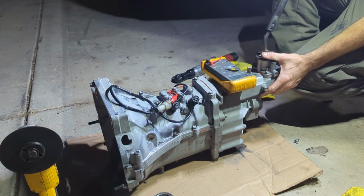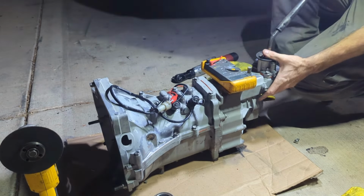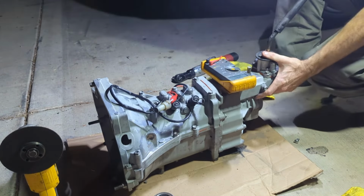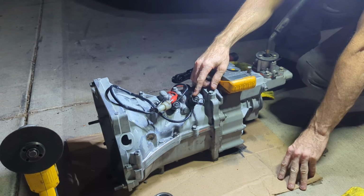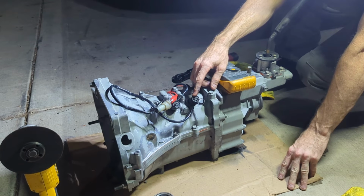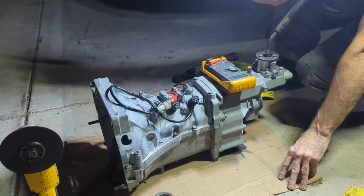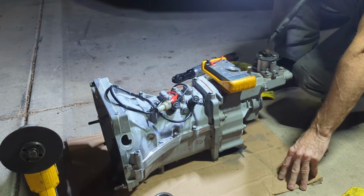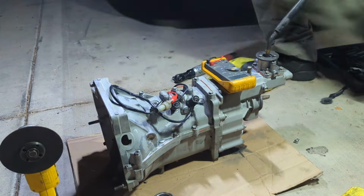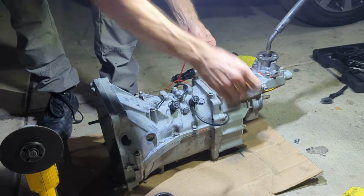and fifth gear, I get continuity. But reverse, I do not. And I think I remember reading something. One of these plugs is actually for like a fifth gear output. I don't know what that tells the vehicle. It tells it it's in overdrive for whatever reason, so I'm not sure if that's even needed anymore. But I can rule out this plug being the reverse light plug.